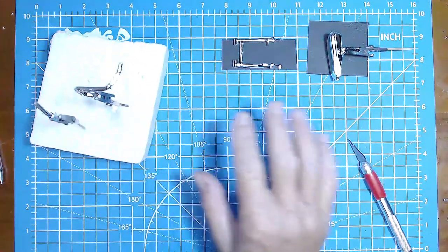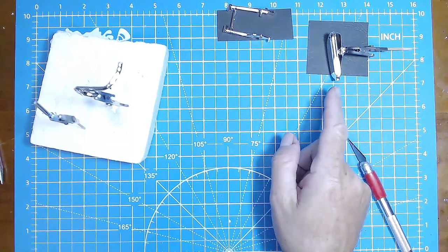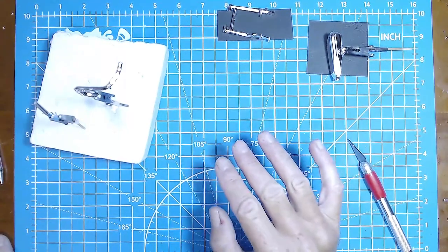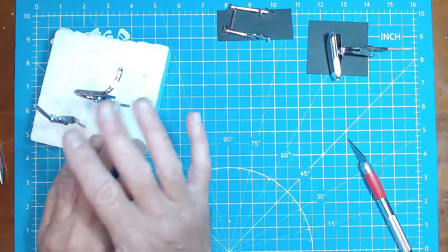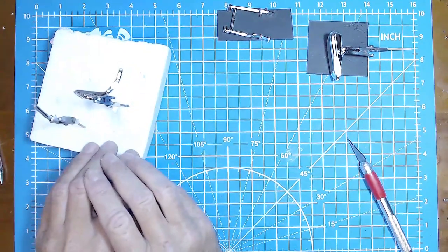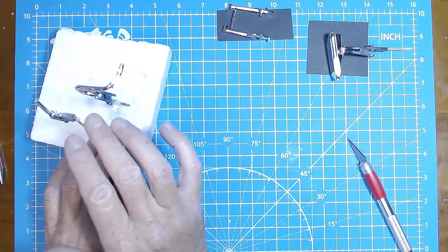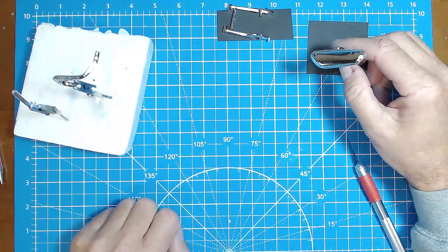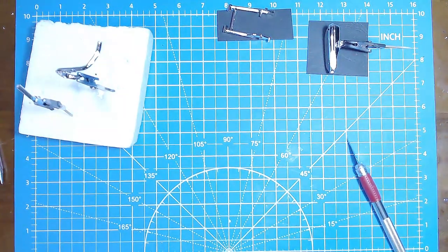What I'm going to do now is go and put some paint on these things. The swing arm stays chrome - that's finished. This may as well be finished, the muffler, so we can cross off step seven as done. Then as we get down to step eight we'll be putting all these on, but I need to re-chrome these. I'll undercoat them in black primer, hit them with the gloss black, and we'll hit them with the Outlaw Paints chrome and they'll be looking good. And of course these need the heat marks done on there as well, which I'll show you how I do. This will be primed in black and then gloss black.